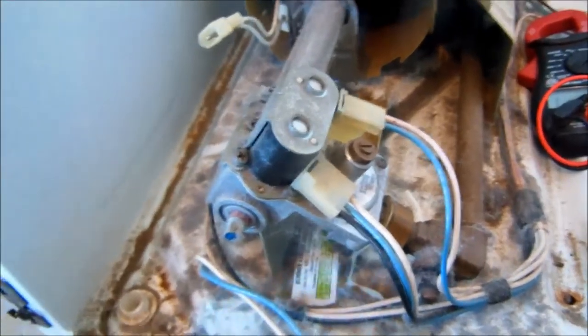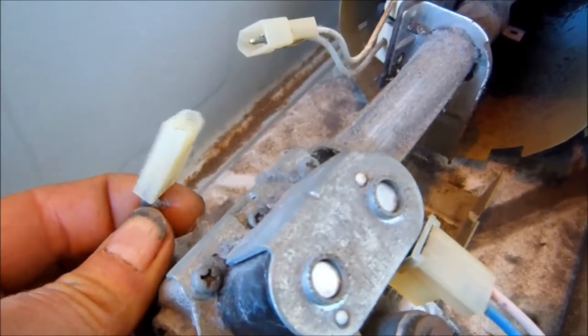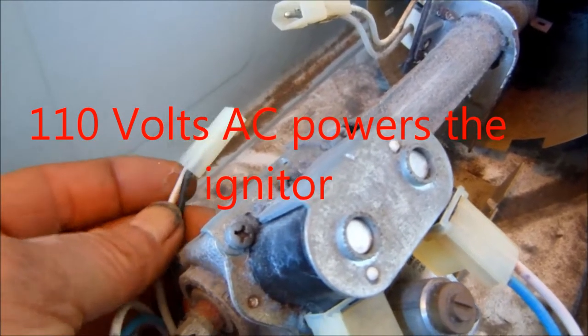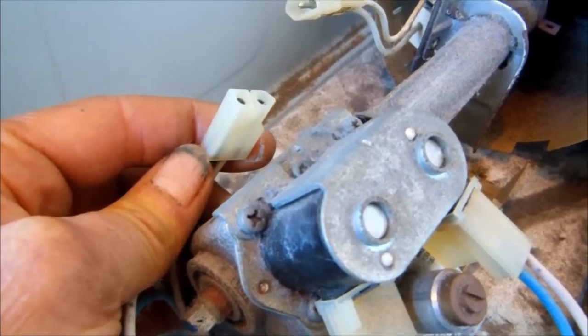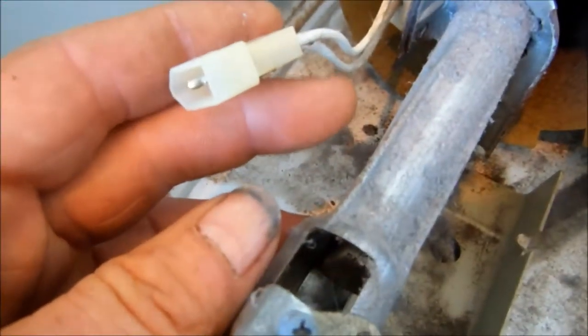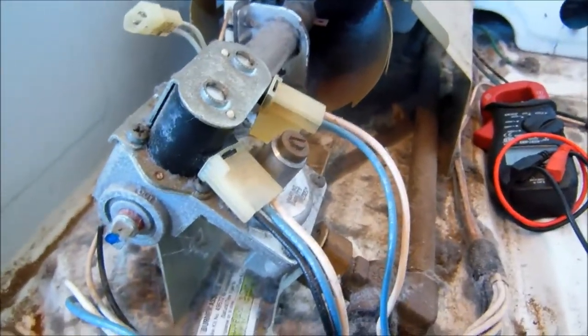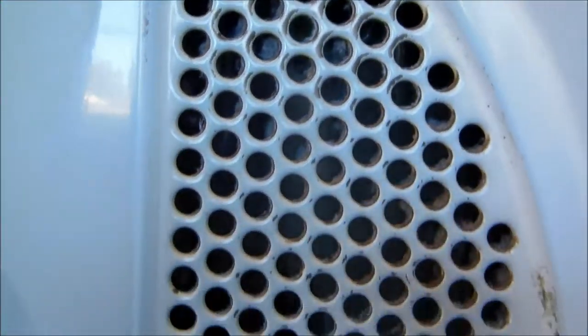Once you've disconnected this line here, you can also test for voltage on these two terminals as you turn the machine on — there should be voltage coming out; if there is not, that could be a problem with your flame sensor. We're looking for continuity across the igniter — I've already done that with the meter and we had continuity, so that igniter is good, or theoretically should be good. Now if we look up in here, we can see a little bit of lint built up inside — we want to clean that out.